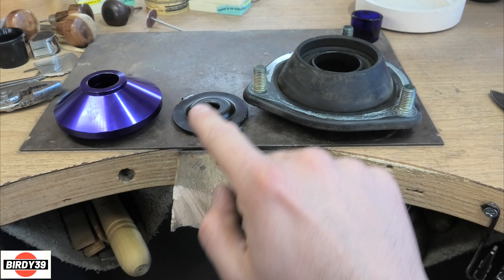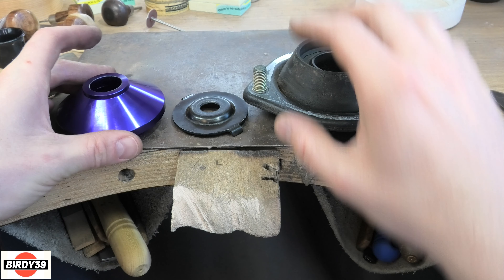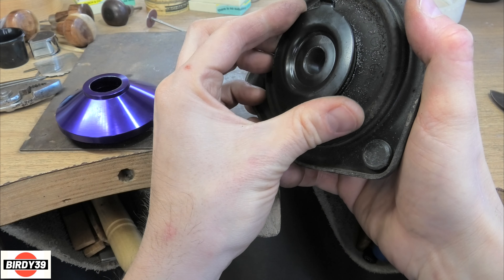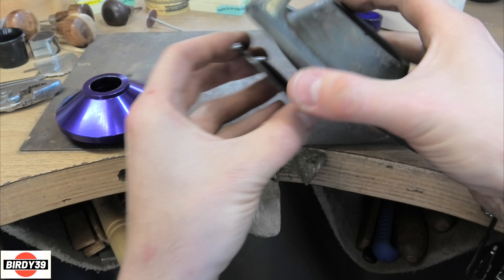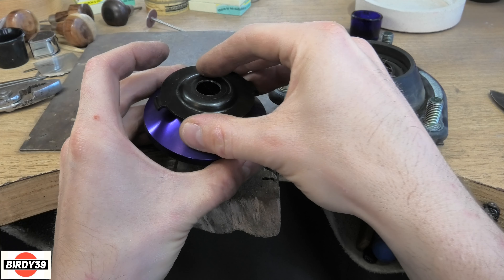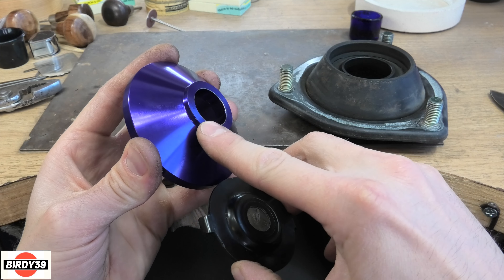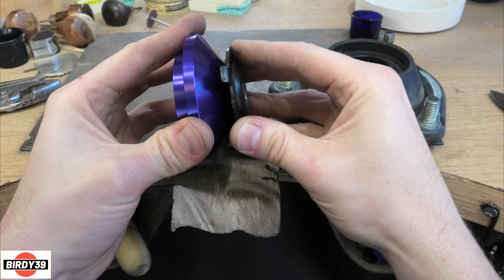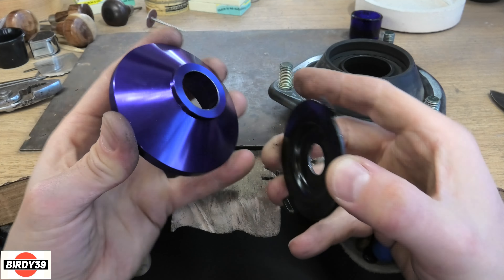The Nissan plate sits on top of the spring on the coilover, and goes under the bearing, pushing against the centre of the bearing. The problem is that piece has a rounded inner edge and the other has a sharp corner, and because of the sizes it doesn't sit really secure. I didn't like that, so I modified them to fit better.